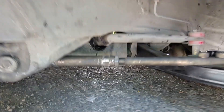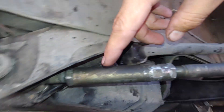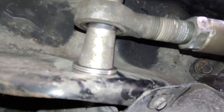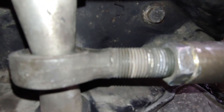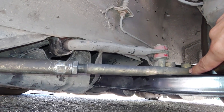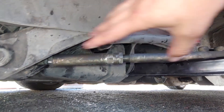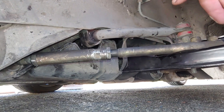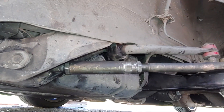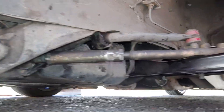The arms don't have a ton of threads out on each side, but there's lots of thread grabbing. Apparently the S14 ones are longer. It fits really good in the plate-style brackets. Looks pretty even on the heim joint. Over here it actually clears around the control arm nicely. They're actually a slightly shorter length than the stock ones because I had to pull the arm forward — about an inch, maybe three-quarters. I pulled the whole wheel forward. They installed pretty easily with the late-model brackets.